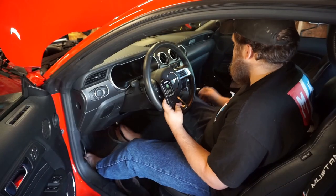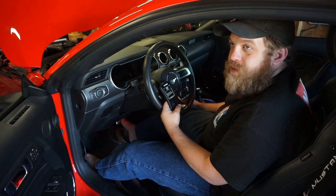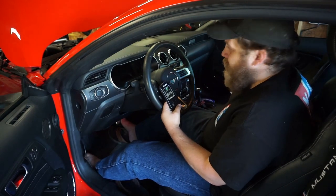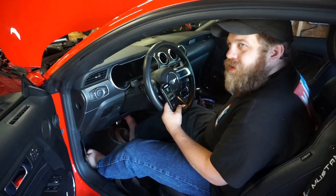That's the install of the Tune Plus internal wastegate actuator on the EcoBoost Mustang. Thanks for watching — please like, share, and subscribe. I've got videos on my channel covering Mustang GTs, Fiestas, and all kinds of things — something for everybody. If you have a suggestion for a future video, let me know in the comments. Drive safe, have fun, and God bless America. I've made the mistake one time of forgetting to wait the 15 seconds after loading the tune — I started the car and everything went haywire. The ignition timing wasn't correct; it was misfiring and ignition was all over the place. It was crazy.